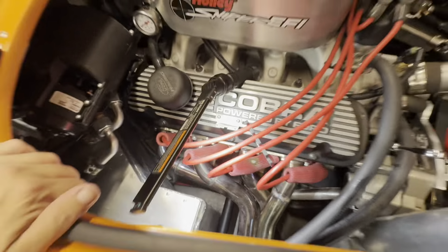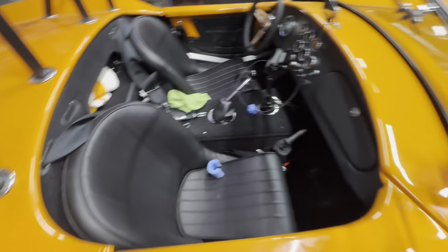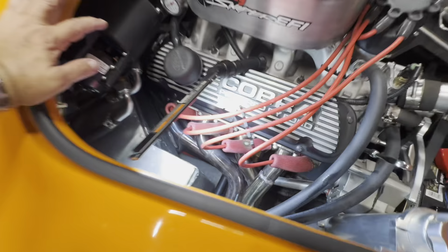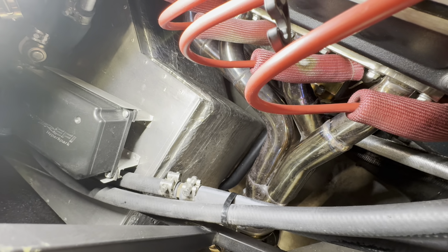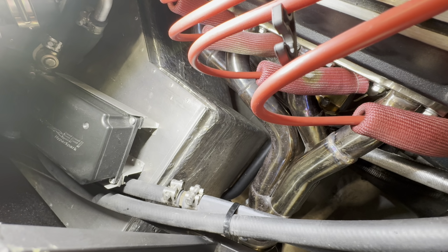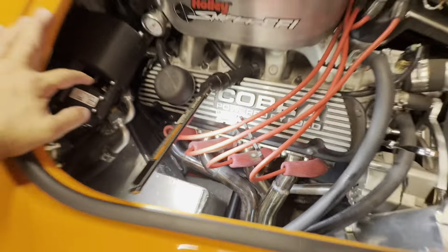Started it up, same situation. The exact same situation, like nothing changed at all. So I didn't bother calling the tech back. I figure that that oxygen sensor has gone bad. I know that when they completely go bad, one way is they just say 35.6 all the time. I went on YouTube, looked around, and other people have said that theirs was doing the same thing mine's doing. So I went ahead and ordered another one.